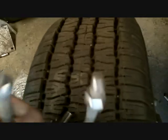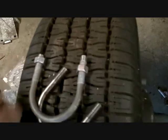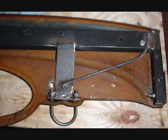I got to clip a half an inch off of this side because there's a button in the way. A starter button right there. Well, horn button, whatever you want to call it. It'll push into it if I push it up too high. If I tighten it, it's going to crush that button and ruin it. But the other side's free and clear, plenty of room. Behind this dash, there's actually a muffler clamp. The bracket end of the muffler clamp is in there, and it's welded to a piece of 3/16, and that's welded to the tube that supports the whole dash, so it's a pretty cool idea.